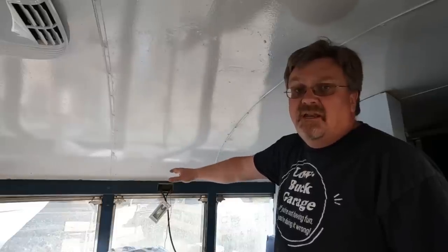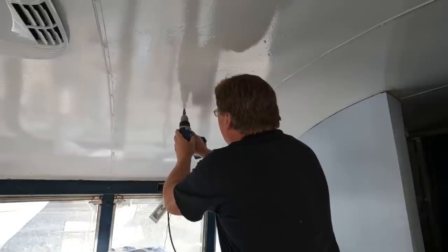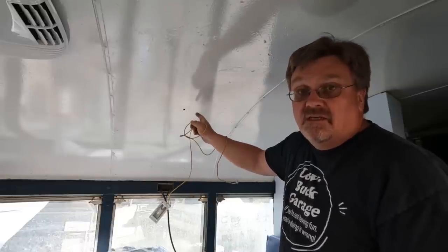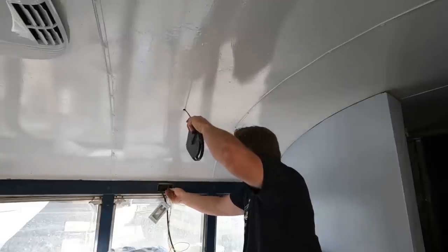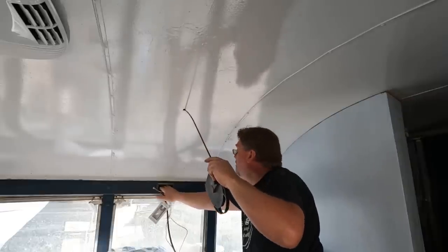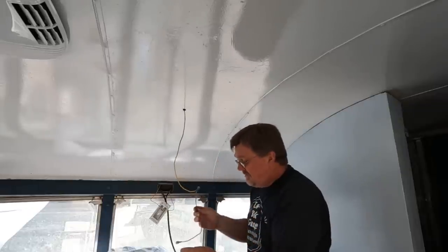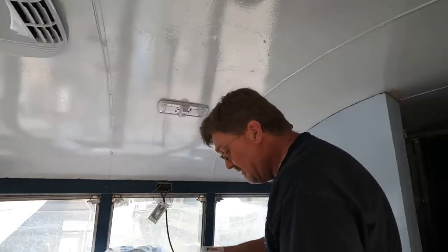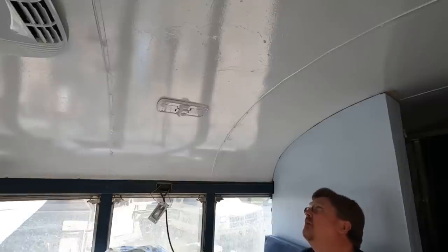I took out the shelf directly over the dinette because it felt a little claustrophobic while you sat there, but now we need a light overhead. This left a wire from the ceiling vent. I'm going to try to run that up and in to get our light here. Got this line for cleaning drains, but it fit fine right in here — a little spring on the end grabs the wire pretty good. They make tools like this for electrical wire; I don't have one, but I do have this one so we'll make do. Found a little rubber grommet. I love self-drilling screws. I always find out stuff is crooked after I attach it — hopefully I can do this one better.